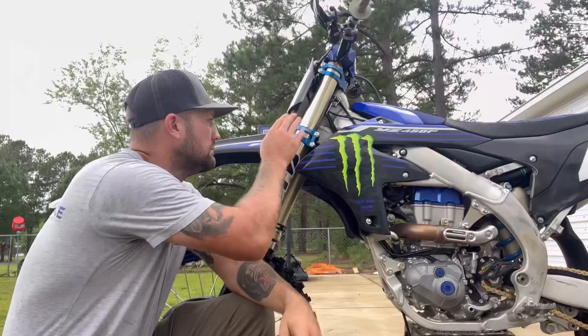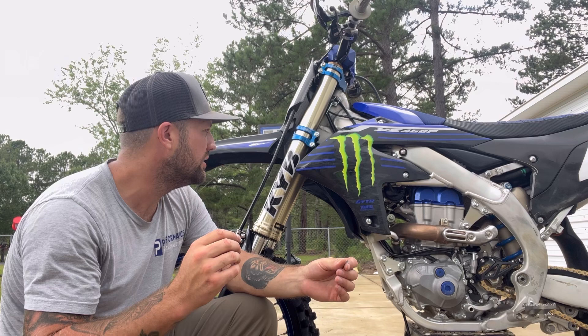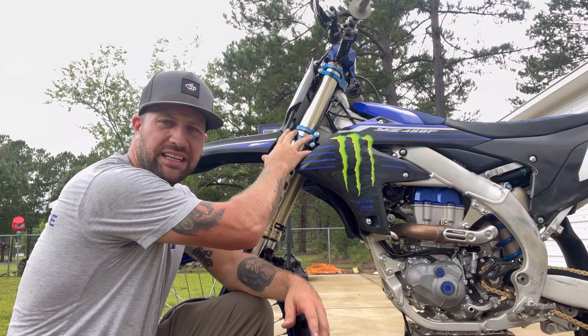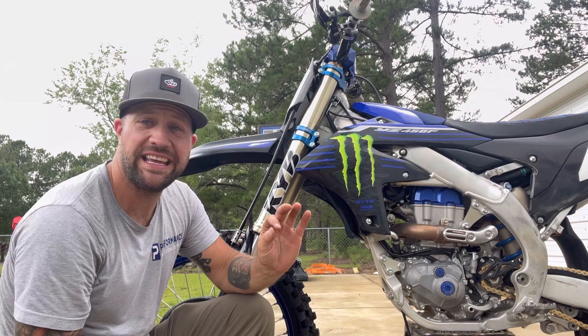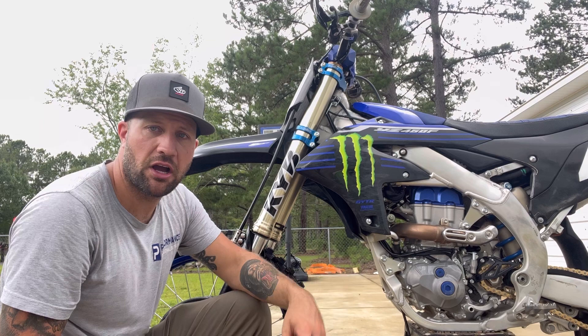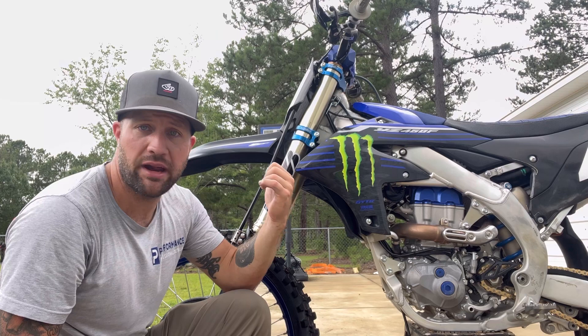Luxon clamps — the reasoning behind that, again, is the horrible carpal tunnel. Anything I can do to reduce fatigue and feedback into these hands, I'm going to do. I've only put about an hour on these, I just got them on recently, so I can't give a ton of feedback. But what I can tell you is it makes the front end feel weirdly soft — I guess that's the flex characteristics of it. At first I thought I needed to adjust my clickers, but that wasn't it, that's just how they're engineered. The weight difference is insane — I'm pretty sure these weigh about half as much. They definitely reduce fatigue. I love this bike, I love the way it feels and handles — it's very, very thin.